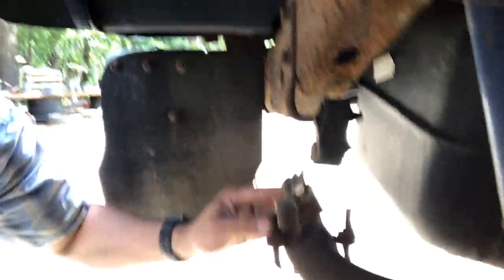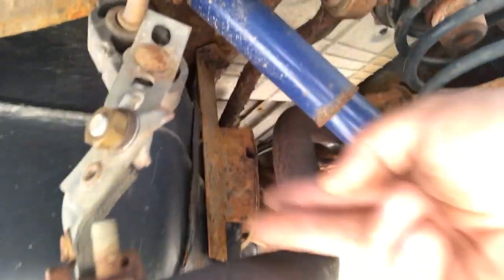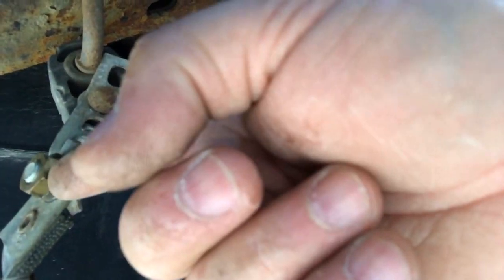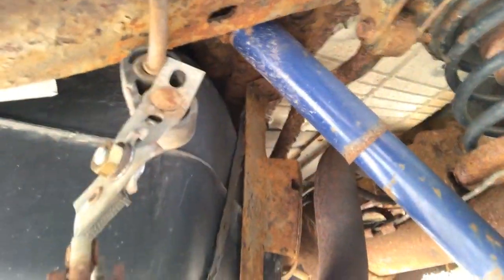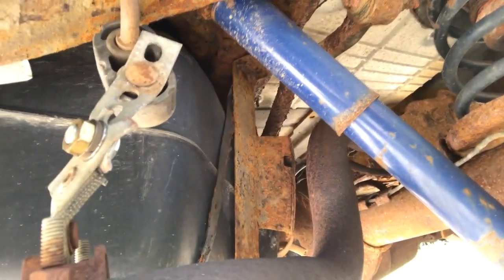I took care of the muffler hanger here that was broken. I put a bolt to it - I did put a washer, a lock washer, and a brass nut so the lock washer will bite into that brass nut and hopefully not back off at all. I think before that comes out the thing will break again in another spot, but like I said it just needs to get us through a year.